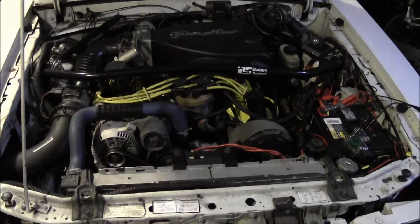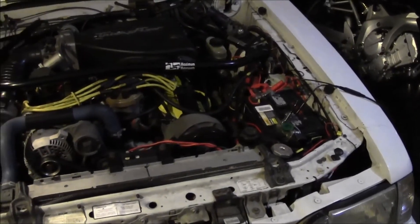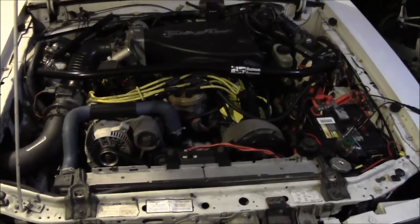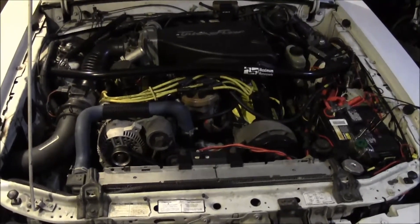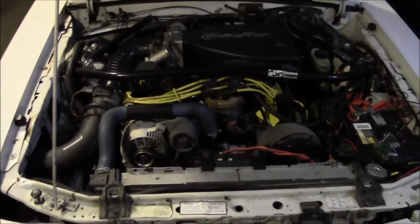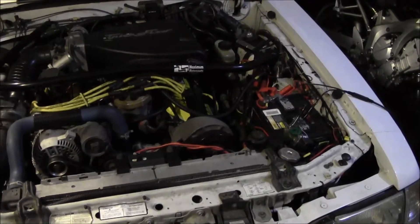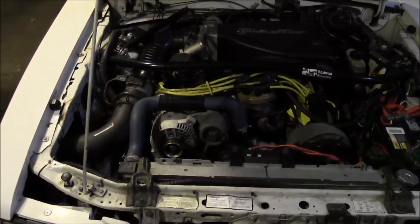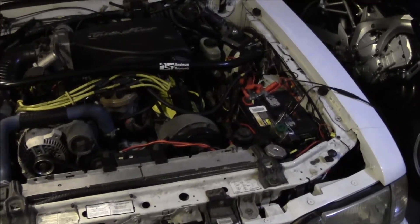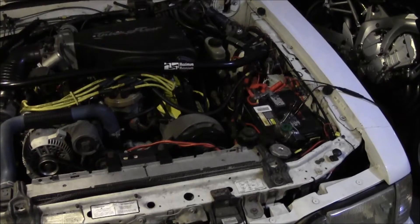Now you're in a situation where the car won't even start. If the battery is that deeply discharged, it really needs to be put on a proper charger. Hopefully this video teaches you how important it is to maintain your battery and the effects it can have on other electrical systems like the alternator. A battery maintainer is probably $25 to $40. It can extend the life of a battery two or three times longer than it normally would last in a colder climate.